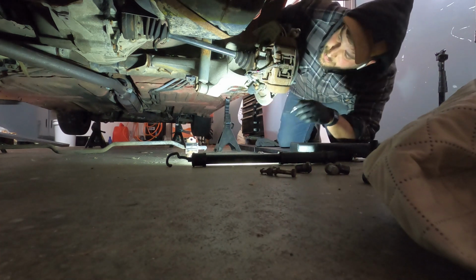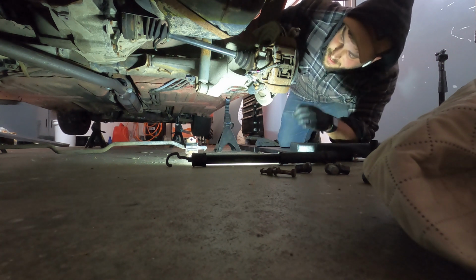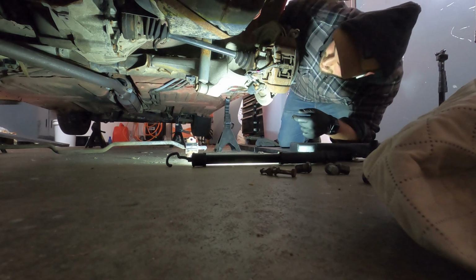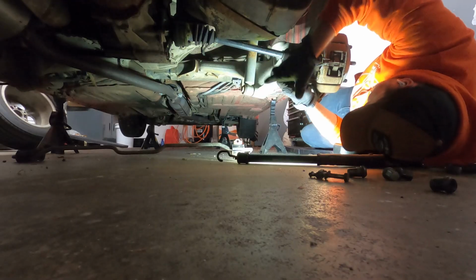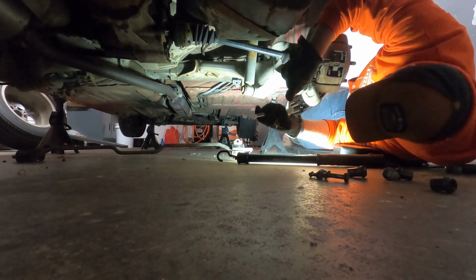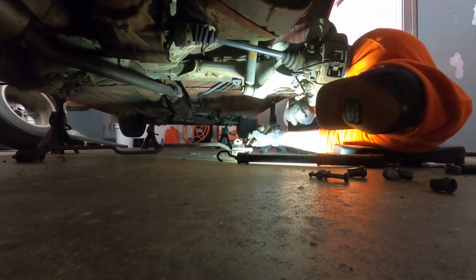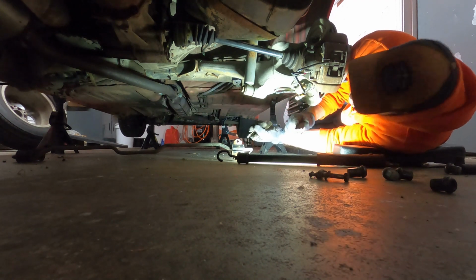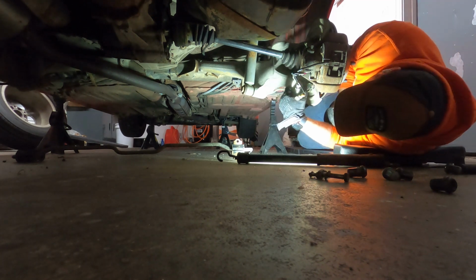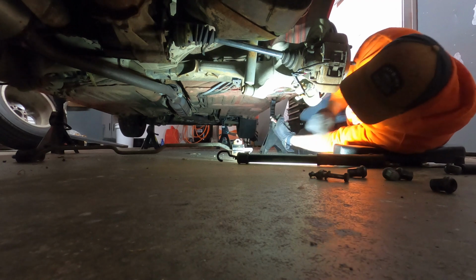All right, that is the rear brake line disconnected and plugged. So run over and do the other side, then we'll unplug the brake wear sensors, then we can start dropping stuff down. So we'll be gluing that back on. I did not realize that would stop the plate. It looked like it would fit right out of that hole, but it did not. So the other side, I'll open this up before I unplug that. Zip tie that in place all together.